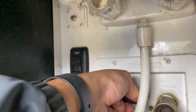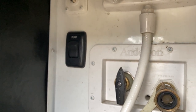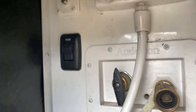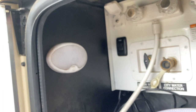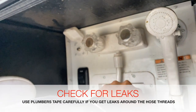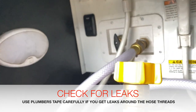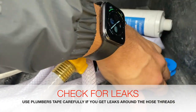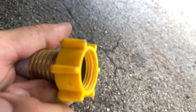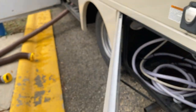When you're done filling, switch it back to normal mode with a firm but not forceful turn — then you'll have water in the cabin again from the tanks. If you don't switch back to normal, you won't have water; a lot of people leave it on tank mode by mistake. You can also get water at some truck stops. Hook your hose to the pressure regulator, make it nice and tight, and run the other end through the hole at the bottom of the RV, then connect to your water source.